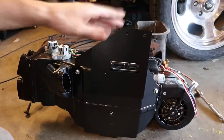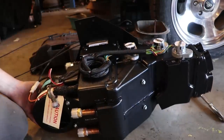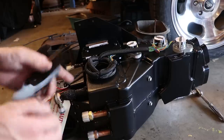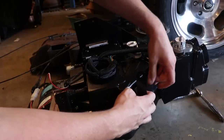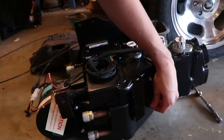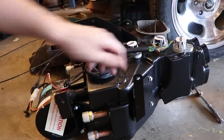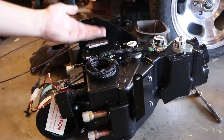This bracket will actually screw to the inside of the cowl, while the one back here has two more brackets that we'll mount to the firewall itself. We've got two brackets and all the screws — all they do is screw right in. We need to leave everything just a little loose so we can move stuff around. Once we get our mounting holes drilled, we can tighten it all up. It says to tighten the firewall mounts first, so we'll get all the brackets in place, make sure everything looks good, and then this will mount to the inner structure of the cowl under the dash.